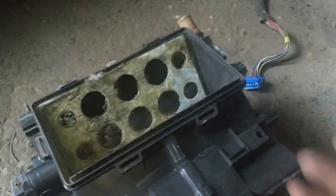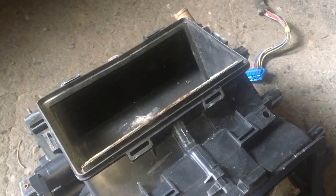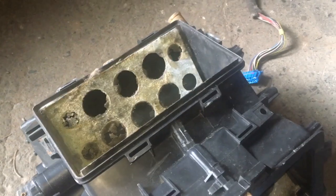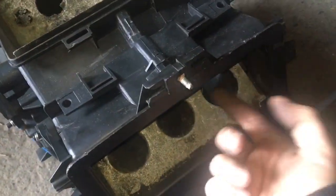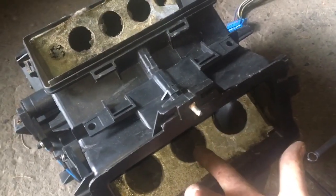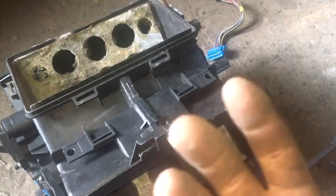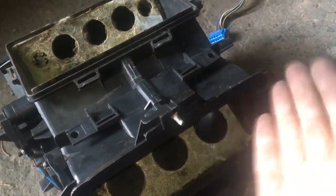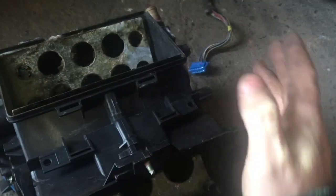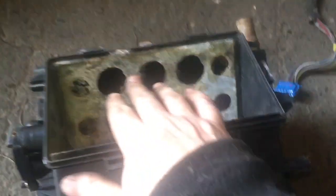The next thing to do is the heater matrix box. The way it works is these are flaps — as you decide you want heat to the windows, the vents, the floor, or wherever, you turn the flaps. These holes were damaged anyway, so what folks can do is make flaps with holes in them, make them super light, and use very light foam across them to help direct the air stream without adding extra weight. When you turn the flaps you're not moving a big load of plastic, so it feels very light and the controls are easy to move.